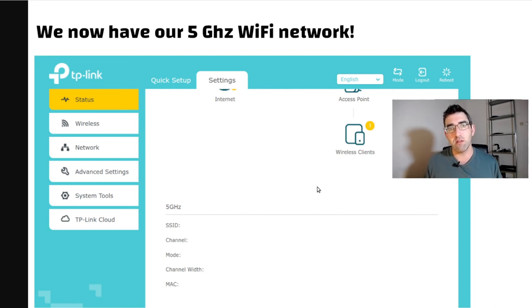If you have bought yourself a router that is only broadcasting on 2.4 gigahertz, but it's already passing through connectivity, and you're not sure whether you can use something like a TP-Link range extender or access point to bring out another wireless network, and especially a 5 gigahertz network, I managed to do so using this setup, using two TP-Link routers on the back of an ISP router and networking everything together, and it's working just fine. And the TP-Link software, I have to say, is really easy to work with, really easy to change mode, really logical, the schematics are good. I think TP-Link has its critics for consumer networking software, but I found all the devices I bought so far easy to work with, with the exception of the load balancer, where the cellular router wouldn't work in bridging mode. That's the only trouble I've had so far.